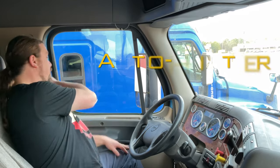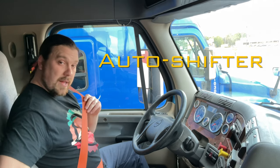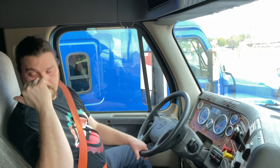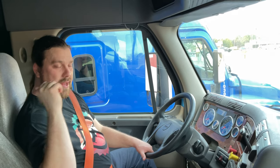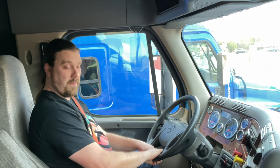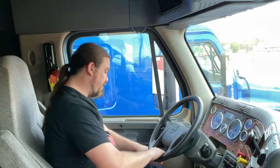First thing I'm going to do is put on my seatbelt, make sure it's not ripped or frayed, and that it latches properly. Secondly, I'm going to mention, make sure that my 10BC fire extinguisher and 3 red reflective triangles are in the back, and my fuses and spare circuit breakers are in the dash. Make sure that my vehicle's in neutral. Then I'm going to start my engine. I'm making sure that my ABS light comes on and goes out.